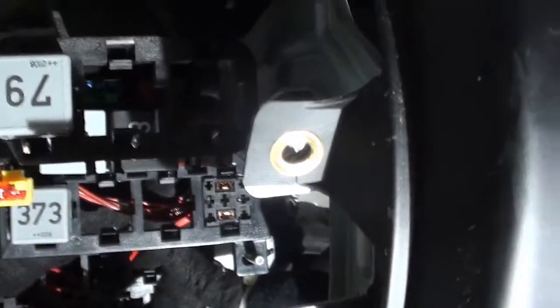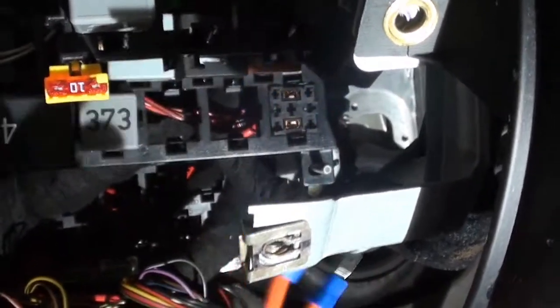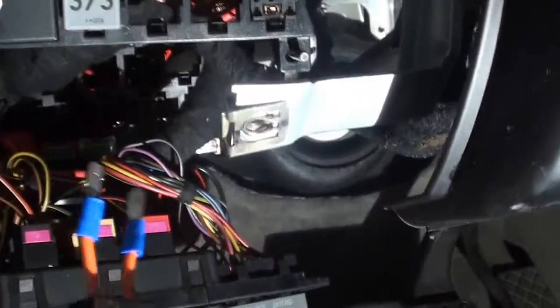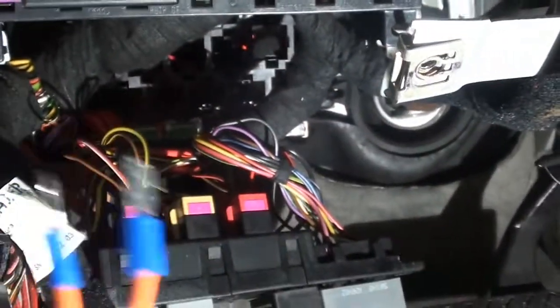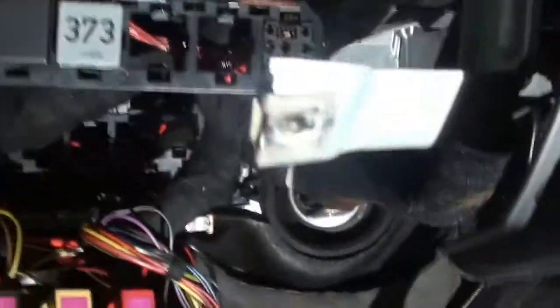Well, I come down here, and just so happens I was up, and I read the thing, and I come down here and looked. Somebody had already made one. Well, they had made one because this was bad already. And they still needed the car to run, and somebody was smart enough to make this. And what was happening is these little Chinese terminals are so thin that they don't get a good enough connection. And when they get warm, they wiggle and get a bad connection. So I came down here and the car started.